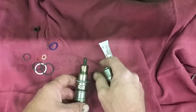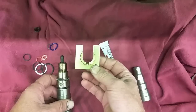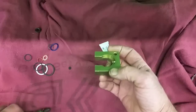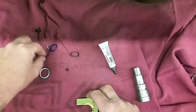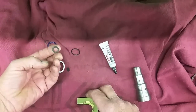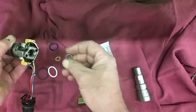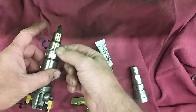Your kit is going to come with the retaining compound, the seals needed, the sleeve, and also the injector tip. You can rent or purchase the retainer — depending on how many you're going to do — which is the part you put inside the vise to hold your injector so you can take it apart. You will need one of these to do it properly. On this seal kit, I'm probably only going to use that one seal and also the ones that mount inside the bore. I've always found that if you try to replace the seal down inside the injector body, there's too much failure. So if these aren't bad, I don't touch them — just leave them alone. You're a whole lot better off not removing that snap ring and not messing with those seals. We'll just do the one that seals it in the bore and then the one that seals the injector tip onto the injector.